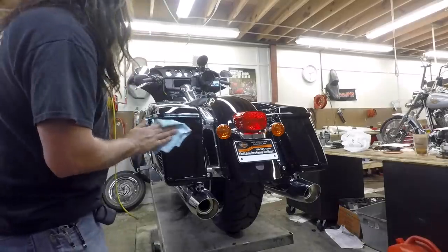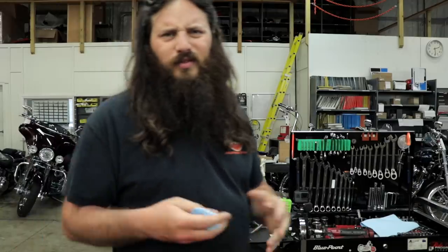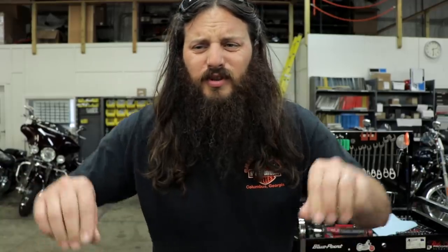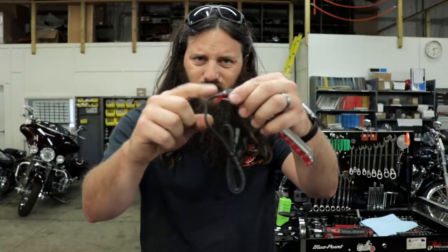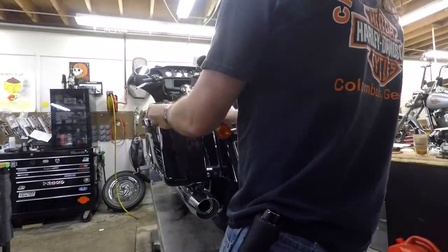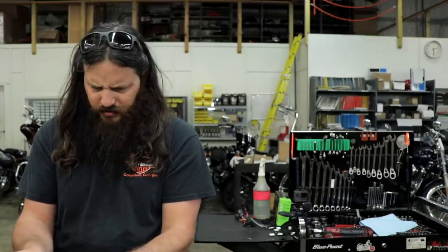These are plug and play, but they're also no drilling required, which means they are double-sided tape. So I'm going to clean up my saddlebag area with rubbing alcohol — Windex works too. I'm going to test fit these to determine left and right side with my lids closed and latched. The little wire piece goes fender side so we can route the wire in a minute. If you put them on the wrong side they don't fit — you can tell they're wrong.